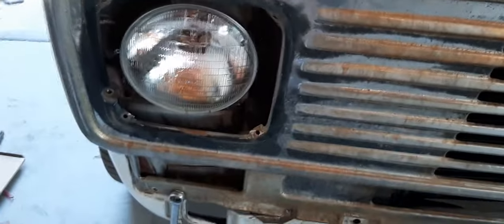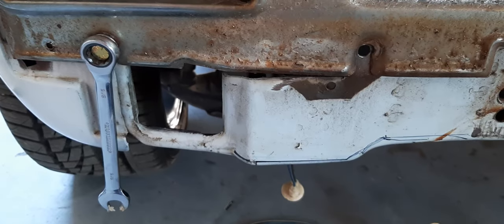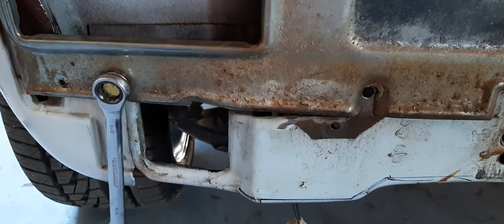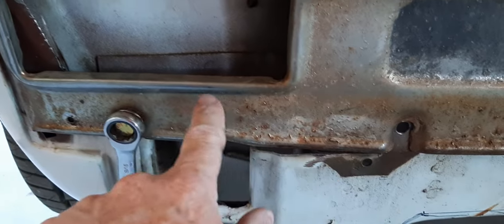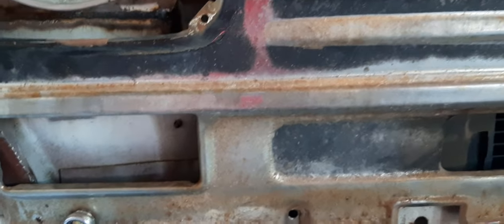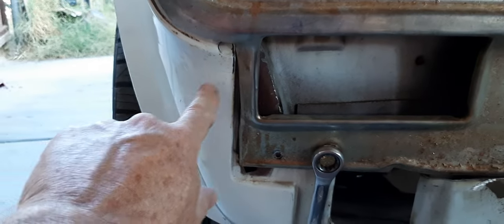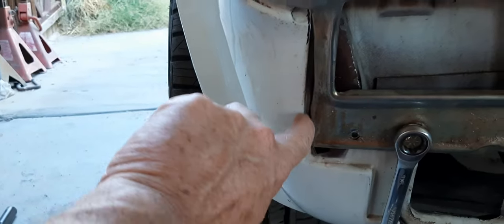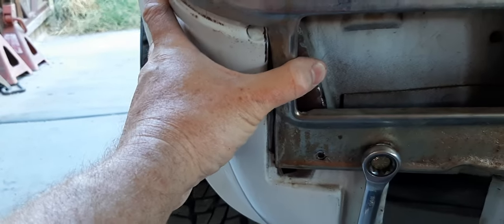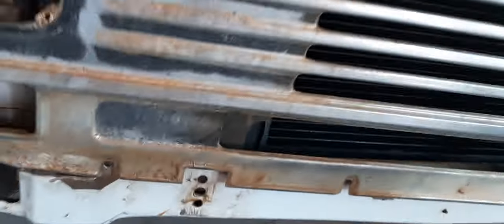Some of the things you're going to need to cut — the way the 78-and-up new body-style grill protrudes out, the old body-style grill will not work unless you make this modification. You have to do some sheet metal cutting. I'll take this grill off and show you. You have to do the same thing on both sides. The grill goes right up against this body molded line — you want to push the grill all the way up against it, and on that side you're going to have to do some cutting and moving of sheet metal to make it fit properly.